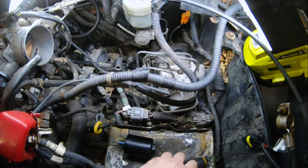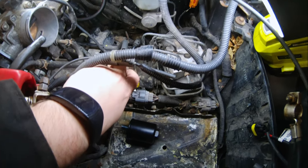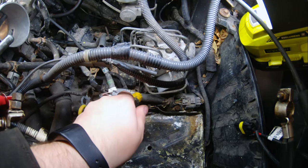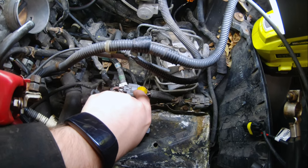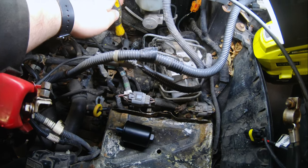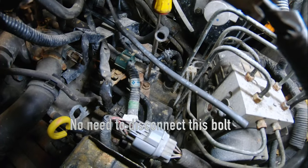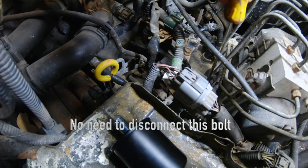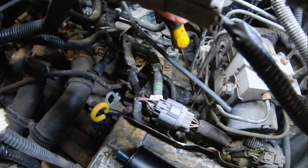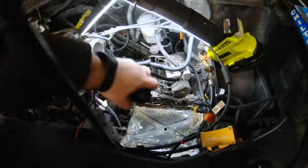To get to it, it's a little tricky. There are two bolts — one up here and one down here by the bracket. You disconnect the part the brackets are holding in, then there's a bolt right here. You put a wrench on here and twist it off.